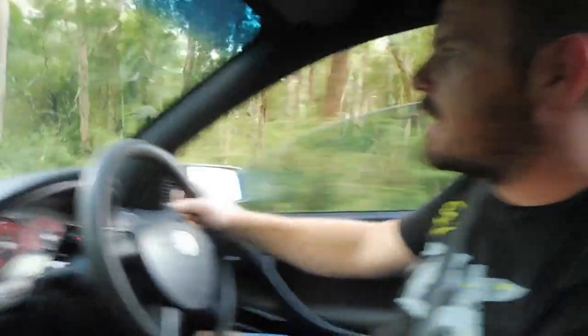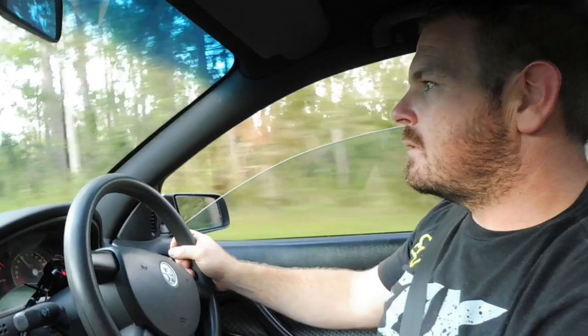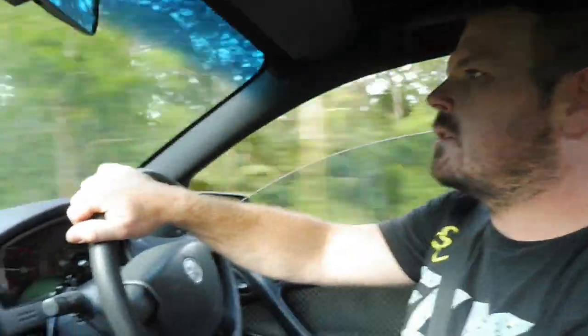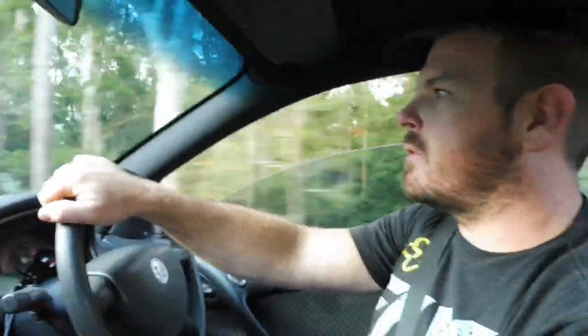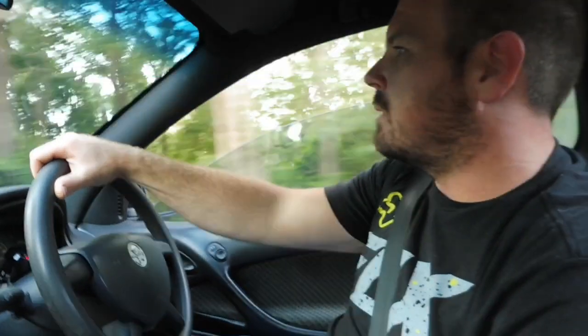I'm not going to show you every part of tuning because it's such a long drawn out process. You can do this hundreds of times to get your tune exactly right. Drive, log, then make changes, then drive and log and check again until you're happy with it. Change terrain, go up hills, different throttle positions. It will give you a wide spread of information and a wide tune. So I'll save this log that we've done here, and I'll go home and we'll do a screen capture of having a look at the log and the changes that we make with the VE table.